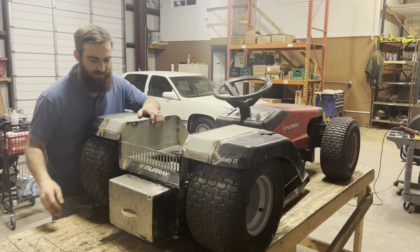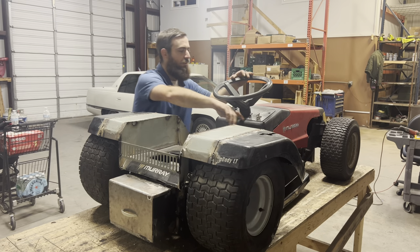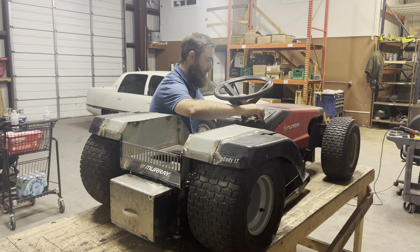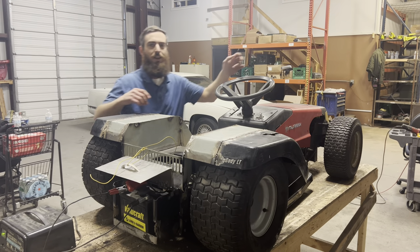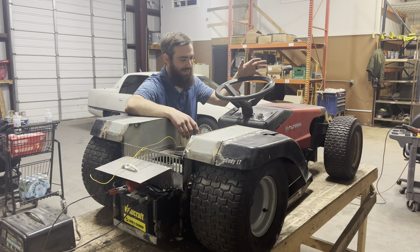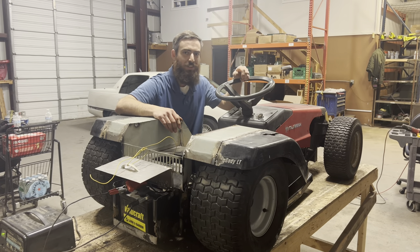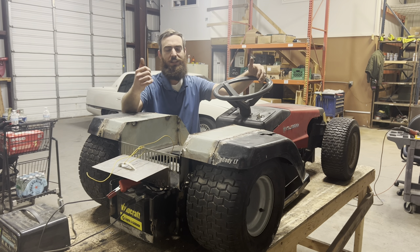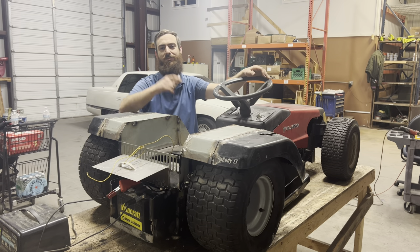All right, well, that's it for the electrical side. We've got our battery box shut — it is snug in there, but it is shut. Let's see if we've got everything figured out. It's in neutral. Well, it seems like we've still got a weak battery — I'm going to put the charger on this and we'll try it again in a minute. I've had it on a 10-amp charge for about a half an hour — let's go for round two. That's fantastic, it turns over! My battery's still a little bit weak so I may just have to replace that, but as far as wiring, everything's good. We have a fully functioning electrical system again, and that's very exciting because it gets us one step closer to our goal of driving this thing out of here. Next week, I'll be working on the shifter and the brake — so subscribe so you don't miss anything. Give me a thumbs up if you like what you see. Thanks for watching, and I'll see you on the next video.